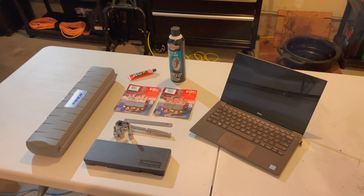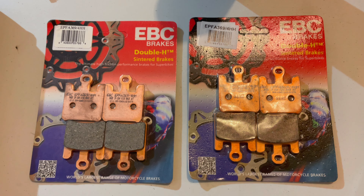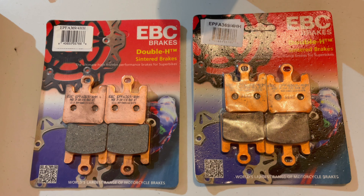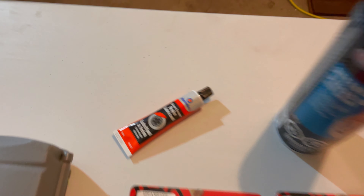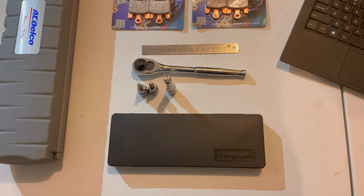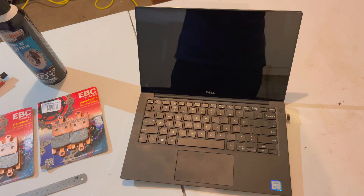What you'll see in front of me is a few items that you want to grab before you start. First of all get yourself some brake pads. I decided to go with the EBC EPFA Extreme Pro Sintered Brake Pads. These have a double H designation — H represents the highest level of friction a pad can give, and double H means the pad retains this level of friction when hot or cold. Next get yourself some brake clean, brake specific lubricant ideally silicone based, a wrench and the bits that you need, some measuring tools if you'd like to inspect the old brakes, a torque wrench, and I'd highly recommend getting a service manual specific for your bike so that you have the torque specs, procedures, and any service limits as well.